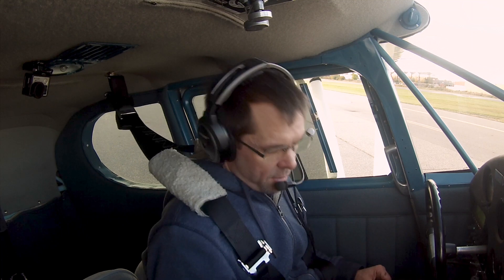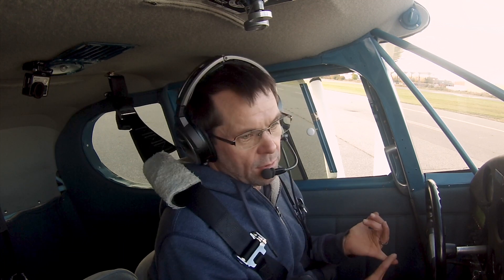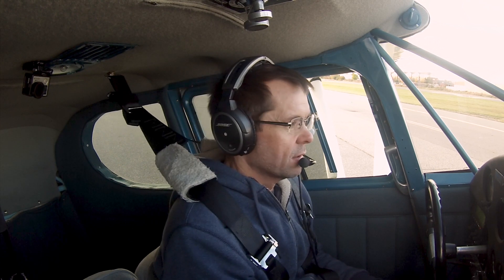So today I'm going to go up. We're going to do some stalls with flaps in takeoff position and stalls in landing position, and then I'm going to use different power settings - maybe 1500 or 1700 RPM. Not full-on power-on stalls. That doesn't give me much information I can use. But knowing how fast or at what speed the aircraft stalls, I can then get an approach speed. Our standard VREF approach speed is VSO times 1.3.